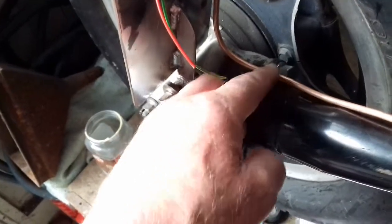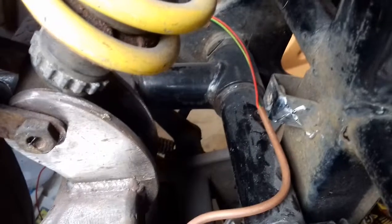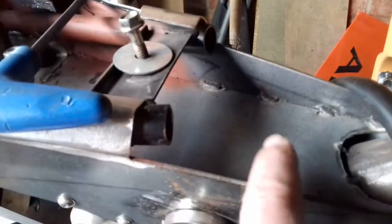So what we'll do is make a little mount here coming off of that - a little twisted flat bit with a rubber - and I'll weld one on here. Obviously can't use the swinging arm itself because it's going to be flipping up and down. We'll put a little mount on there and run the wire up, because I've got the other wire coming up from the brake switch, and they can join into the rear loom that's coming out the back of the engine. That's the only wires I'm going to have on the back.